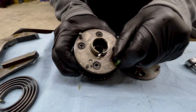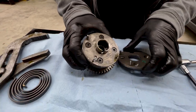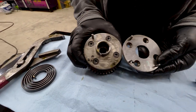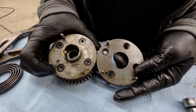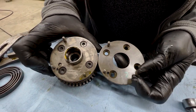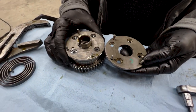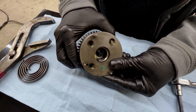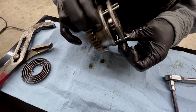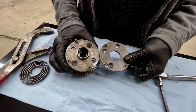This is the McLaren cam phaser, and it's probably important to start looking at similarities inside. If we look, we're going to find we've got the same dowel pin, the same three external pins, everything in the exact same orientation, and the spacing is the same. This is going to be the same unit inside — I'm confident. Let's find out.